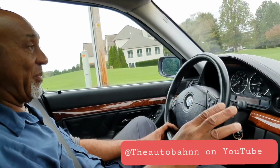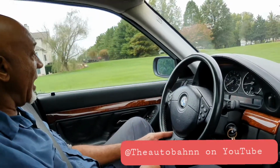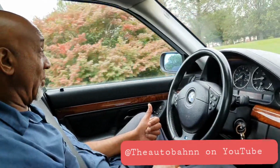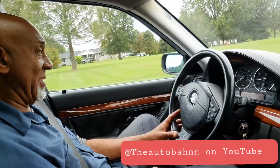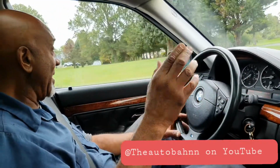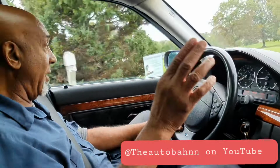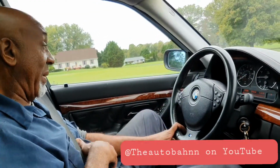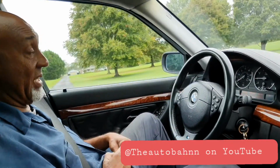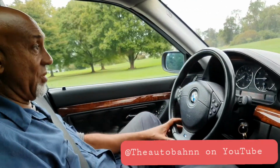Now the drivability part of it on the road, I replaced the front struts, I replaced the control arms, and when I went to align it, I couldn't get the car aligned. The wheels in the back had too much camber, no matter what, they couldn't get it aligned, because actually BMW comes with a negative camber on the back, but still it was way too far off. They told me the bushings in there were bad, and when I looked online, the bushings don't come separately. They come with the control arms on the back, and one arm is like $450. So I said, I'm not doing that.